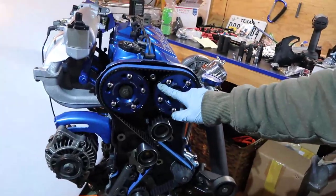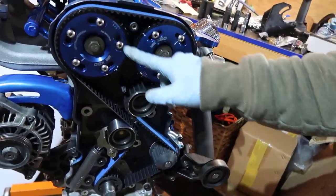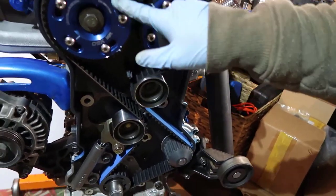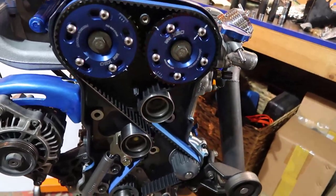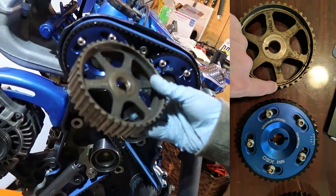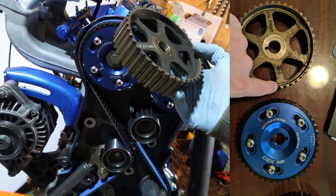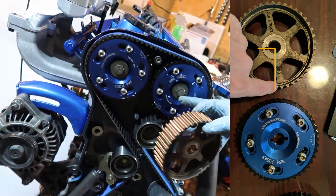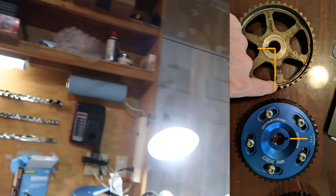Second thing is, be sure that you do not use this blindly, because I was about to. And if you're going to use this here, those markings in here, the ones that come in the cam gears, be sure that they match your factory ones. Mine didn't, and I was like, man, this is not right. That doesn't sound right. So as you saw in my video, check out where the dowel hole is and where your marking is. So in this case, dowel hole down, marking on the right. And in this case, dowel hole and marking on the top or on the bottom, not even right or left. So I didn't have an option.